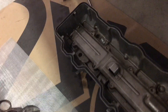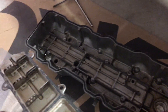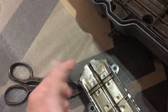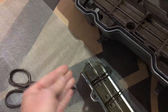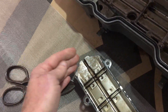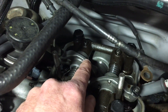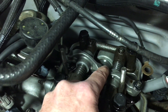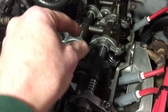As a result of that, I'm scratching my head. The only thing I can figure is that perhaps the last little section of the camshaft, which sticks out — I've taken this little end and bent it up and hammered it flat in an effort to block off this area. I have a suspicion that my increased oil flow may be causing this area of the camshaft to sling oil up and have it pooling on the roof of the valve cover.